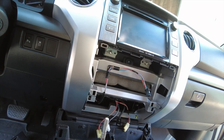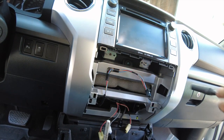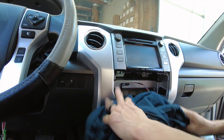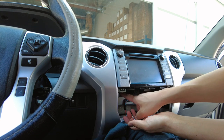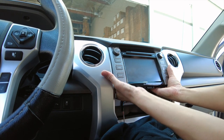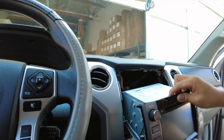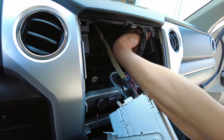Make sure you don't lose the bolts — the deep ones are on both sides, then remove the shallow ones. Go ahead and lay a thick towel especially around your shift knob, you don't want to scratch that. When pulling it out, these brackets are very sharp — make sure you don't make any contact between the bracket and any of your interior parts, because you will leave a scratch. Grab it with two hands and pull it out like so.